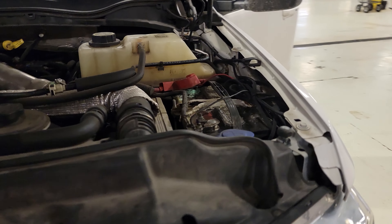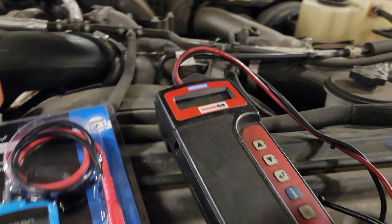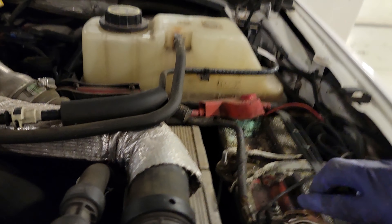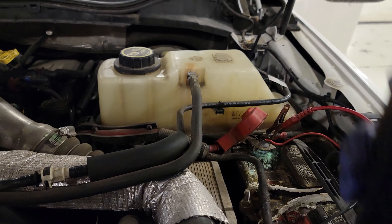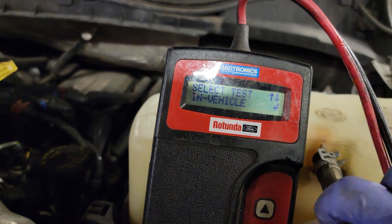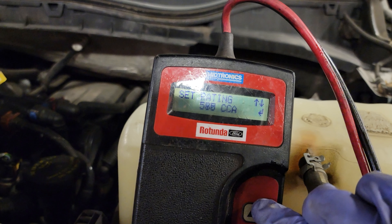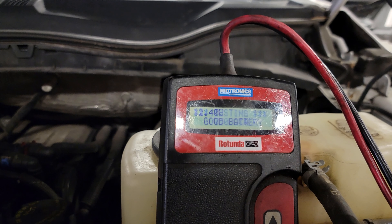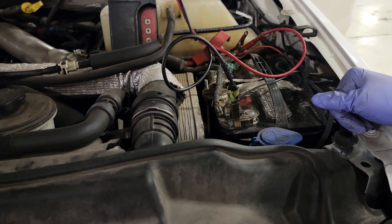So the question is: how do you know the state of charge on your batteries? We have a couple of tools. This one is a dealer tool we've had for quite some time. It's very simple — literally hook up the leads just like you see me doing, and the unit turns on. It asks a series of questions: in or out of vehicle, select the CCAs. We'll go to 750 because that's what this truck has. Hit testing — says good battery.